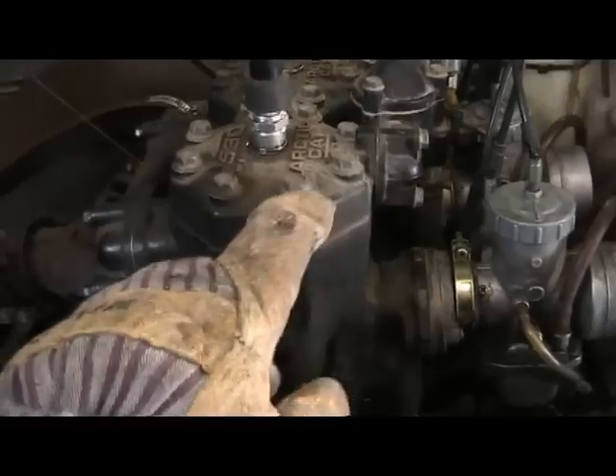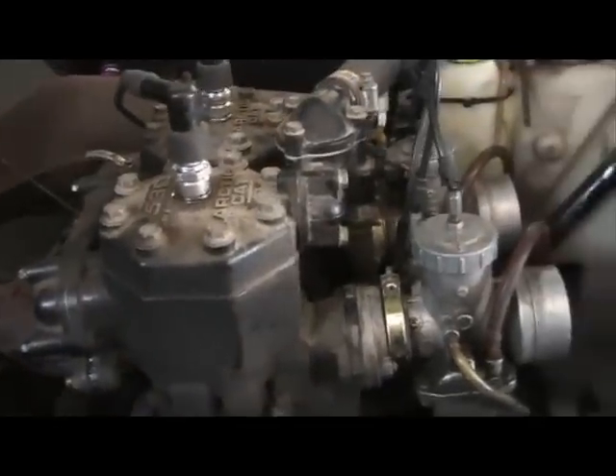There's also a very tingy sound — kind of a dry tingy, like a machine gun going off — and what that actually is is detonation within the cylinder due to the lean condition and the heat in the cylinder. So now that we have properly diagnosed this sled and I've shown you guys what I do, I am going to show you how to fix this particular problem.